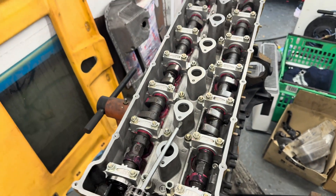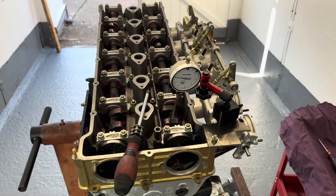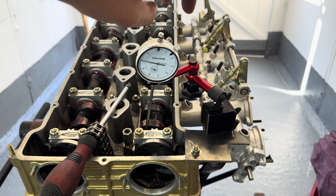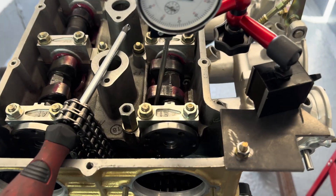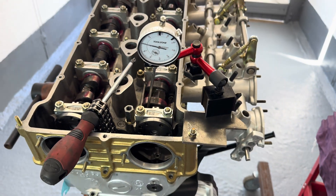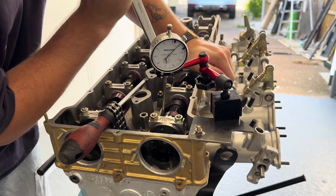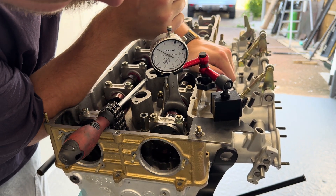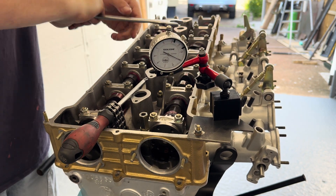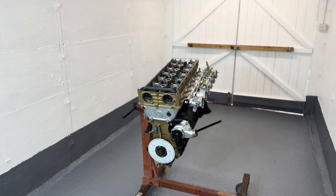These are Schrick cams with a 284-degree sweep — a 20-degree increase from the standard 264. That means the valves at top dead center will be open a lot more than standard. Initially I was told it was 3.5mm of lift at TDC, but after emailing Schrick they sent a new document showing 2.84mm. All I'm doing here is starting with the lobes off the valve, setting the DTI to zero, then rotating until I reach the desired number.